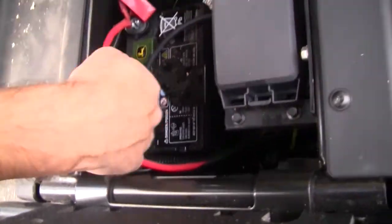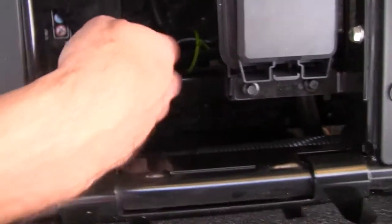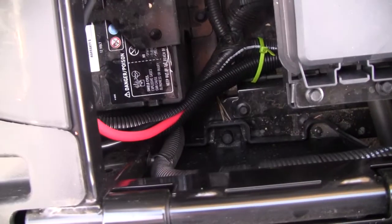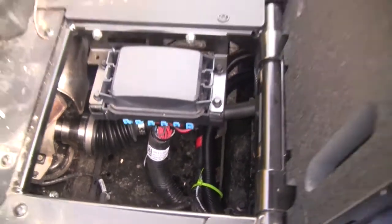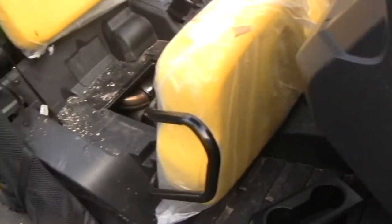So the red and black wires I just routed underneath. It's really close to where the other winch wire is but it goes underneath up through the frame — making sure that you don't make contact with the drive shaft here. I just did a couple of zip ties to keep it away from there and keep it mounted. I basically followed the same path that the wiring harness takes for the winch harness.